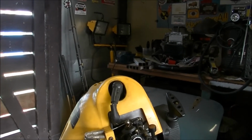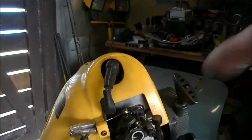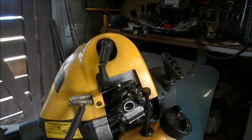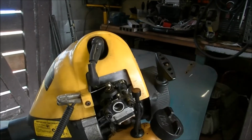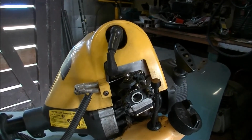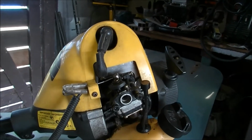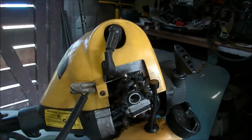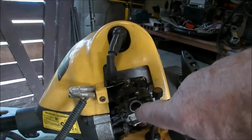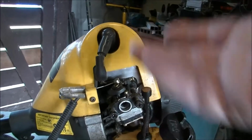Now, a couple of options we had there was to either find some other carburetor for it, or we can just mess about with this a bit. I do have another carburetor, but it's off a 50cc something or other, might have been a motorbike. I think it's just going to be out of a bit off the planet, because I doubt we'll have enough airspeed going through that big Venturi onto the other carburetor, so we need to have something to be able to pull that through.